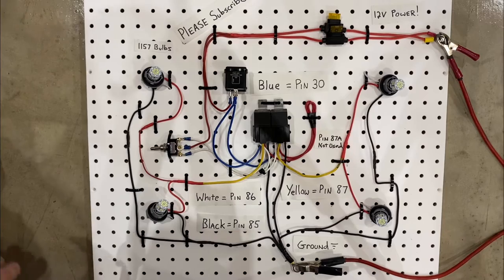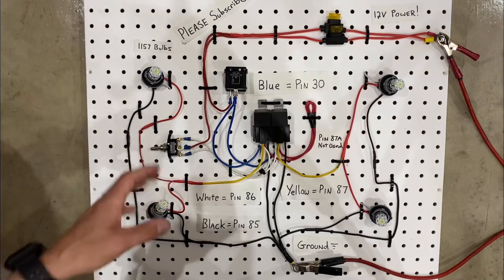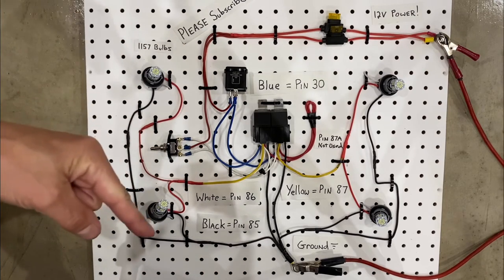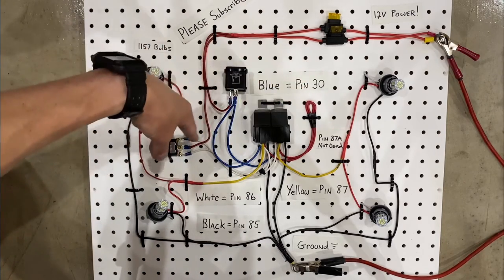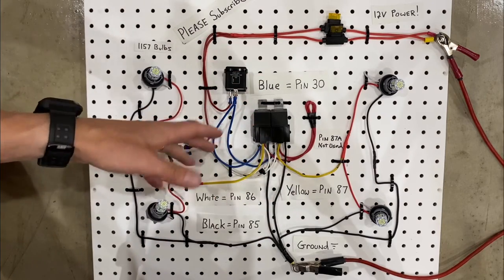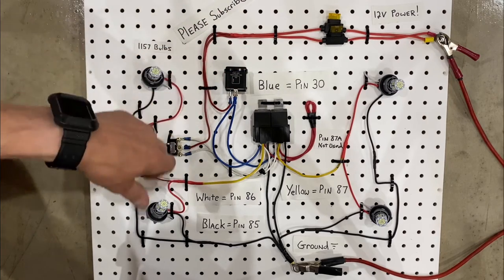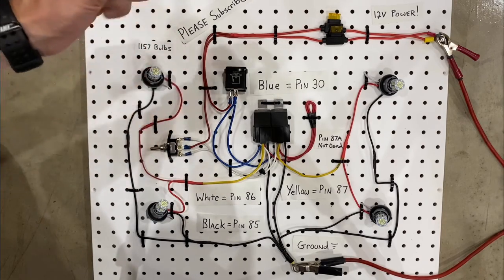All right, the last question that always comes up is, what size fuses should I use? And honestly, that really depends as well. It depends if you're using LED bulbs or if you're using incandescent bulbs or how many bulbs you're using. I actually made another video that I will link down in the description that gives a really good explanation of how to determine the fuse size and the wire size of your whole circuit. Because if your wire sizes are too small, you end up melting them and lighting fires. And if your fuses are too big for your wires, you end up with fires. And if your fuses are too small, then they pop all the time. So it takes a little bit of math, but I have a whole video that is really simple to understand, and it's right down in the description.